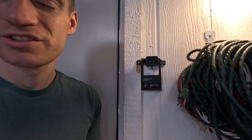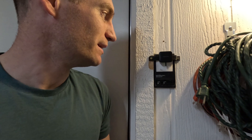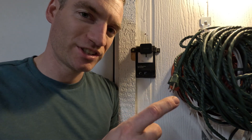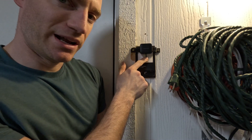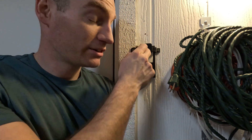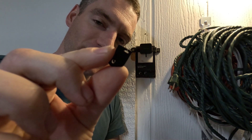Disregard all the stuff in the shop — we've got a lot of projects in progress. Let me explain why this works and why it's better than rewiring your whole garage just for a $25 widget. The problem with SwitchBots out of the box is they have a limited amount of force and travel, which is a challenge for garage door openers. Liftmaster-style openers require a fair amount of travel and force to push the button, and the SwitchBot only has a small electric motor with a little arm for leverage.